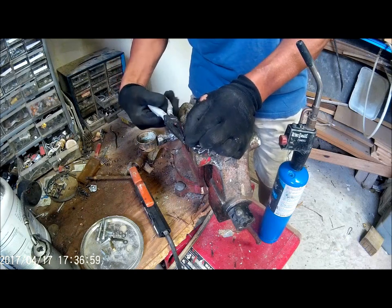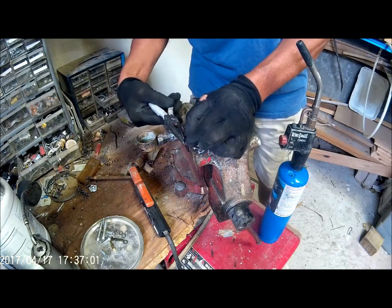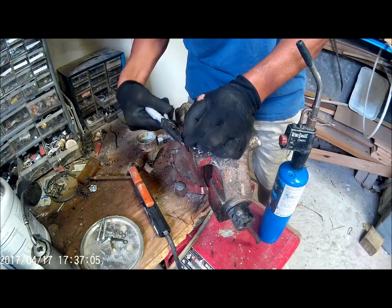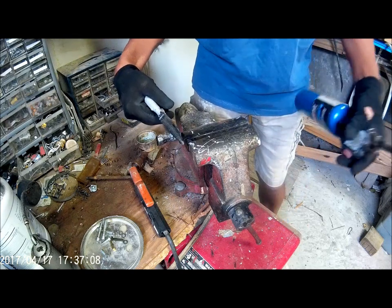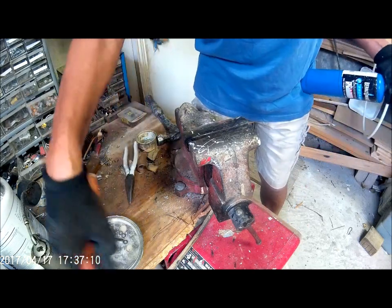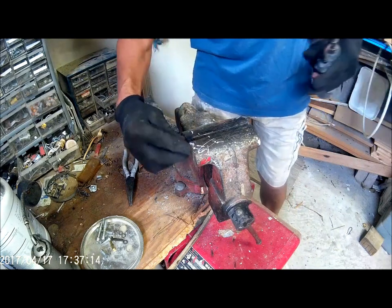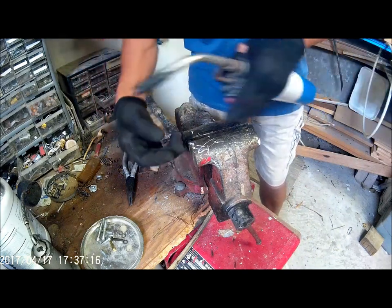It's almost like a bowl, about a 70-degree bend. As soon as you start bending this steel, it breaks. So we're going to heat it up with the torch until it's soft, then try to bend it. Otherwise it's just going to break — let's give it a try.